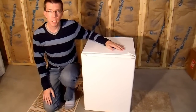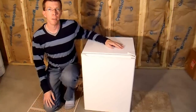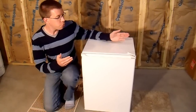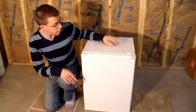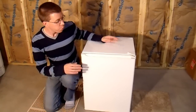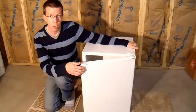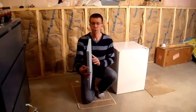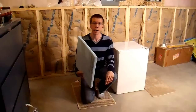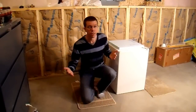This simple hack only took a few minutes and a few dollars, making the refrigerator 20% more efficient — but that's not good enough. The goal is to make this fridge as efficient as possible. The next obvious step is better insulation: it just has a standard blow-molded plastic interior, some low-quality foam, and a sheet metal exterior. So let's add insulation to the bottom, top, and two sides, leaving the door for now. I need to find insulation material — the obvious choice would be the one-inch closed-cell foam I used on the back, but I only have one piece left and don't want to buy more.